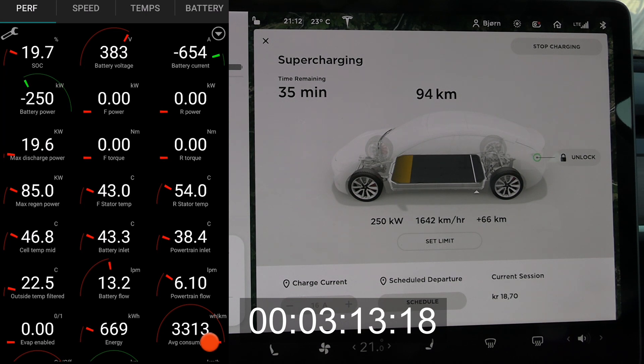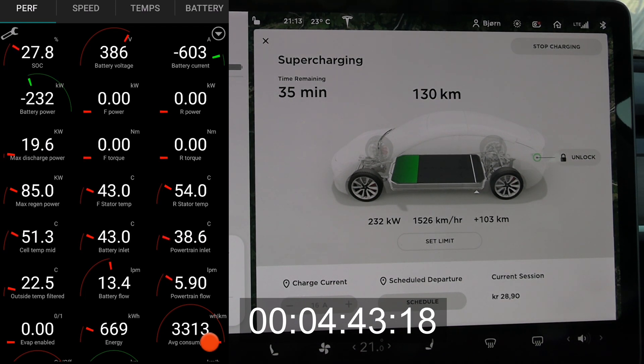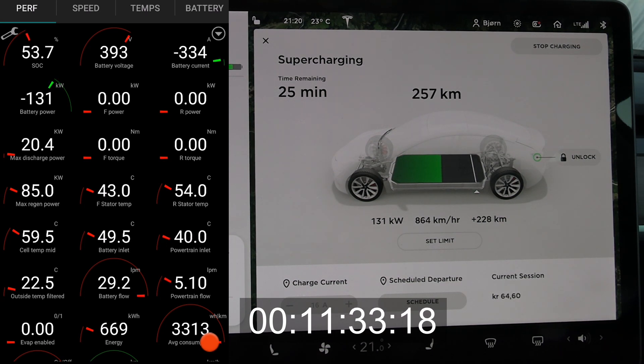Based on this, fast charging actually is bad for the battery. If you Google it, fast charging degrades the battery faster. What happens in Tesla and other EVs is that temperature rises during fast charging. Tesla and many others — like the Taycan — actually actively heat the battery up to over 50 degrees Celsius so it can take faster charging. Batteries don't like being at that high temperature for too long. Each fast charging session is roughly half an hour, so you spend about one hour at high temperature per session. If you hammer a lot per day, that becomes many many hours at high temperature — and that's what kills the battery over time.